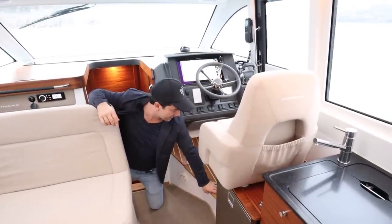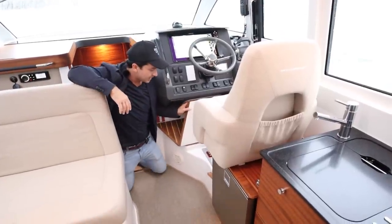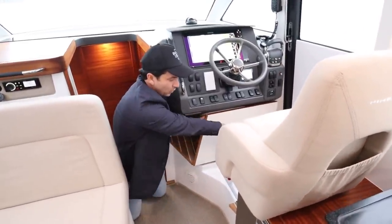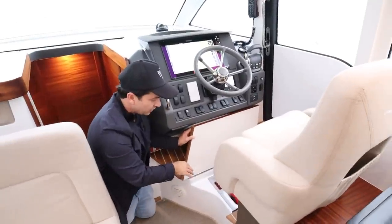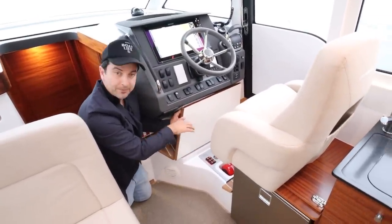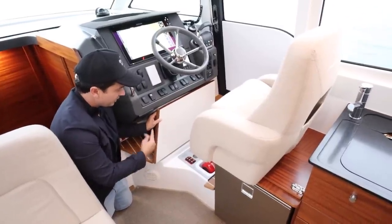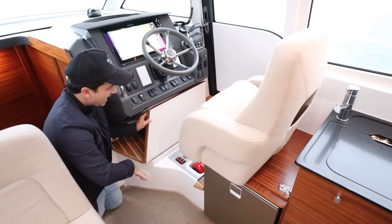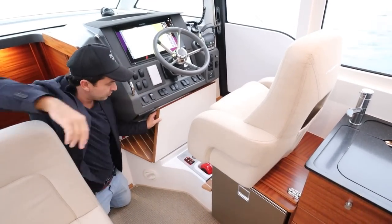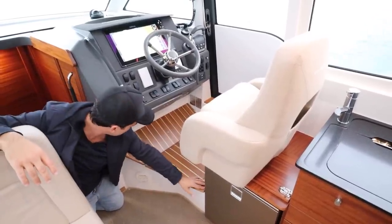Now, underneath the helm is how you activate your systems at the beginning of the day. So underneath, I'll cut to a shot of this, Mitch, there is all your fuses and your engine auxiliary and your heavy auxiliary battery switches. So that's all there. You've got your water tank gauge as well, fuel tanks at the dash, and all your fuses, which are just pencil fuses. They pop out and you just push them back in if they blow. And there is a fire extinguisher in that location.